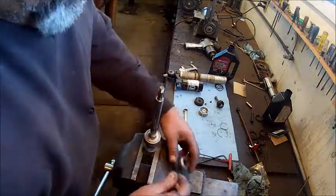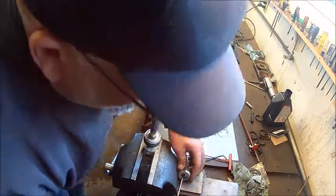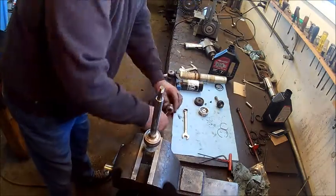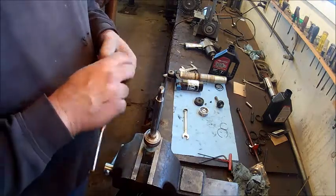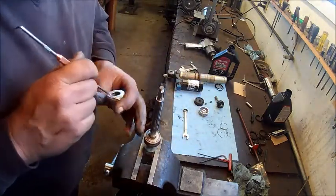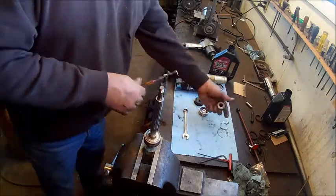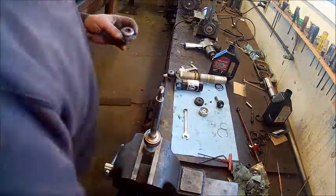Gland off. Take the pressure seal out of that. That holds the oil back from leaking out the rod. It's kind of hard to get into without stabbing yourself. Alright, there goes that. And there's a hard backup plastic washer in there too. Outside O-ring.